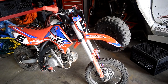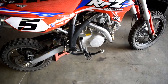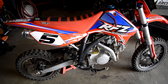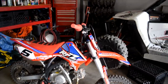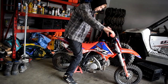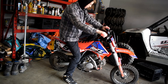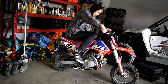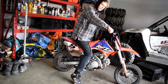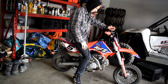This bike does only come with a kick start — there is no electric start. It is relatively easy to start and usually starts on the second kick every time. I've never had any issues with cold starts, it just fires up every time. So let's go ahead and turn it on and see if we can get it to boot up right from the get go. Cold start, hasn't been run at all today. Turn the fuel on, choke on, kill switch on, make sure she's in neutral, key on. No problem — of course it's cold so it's going to die, but I'm not trying to keep it running.